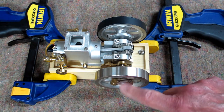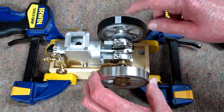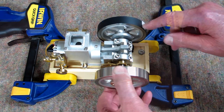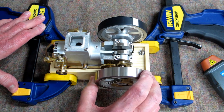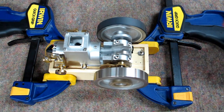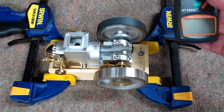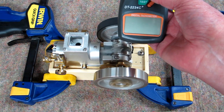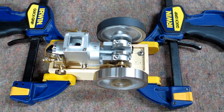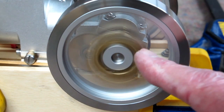The ET7 has the original springs that came on the governor. I put some black electrical tape around this flywheel and I have two reflective strips approximately 180 degrees apart. That's showing 3200 RPM — we divide that by two, so this is running about 1600 RPM. With the original springs, that's about how much those weights are expanding.